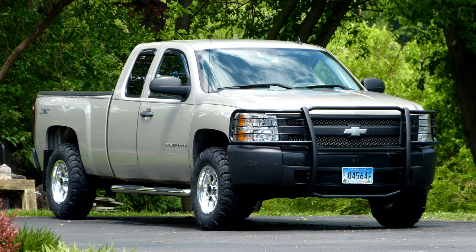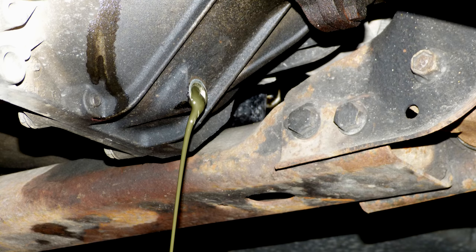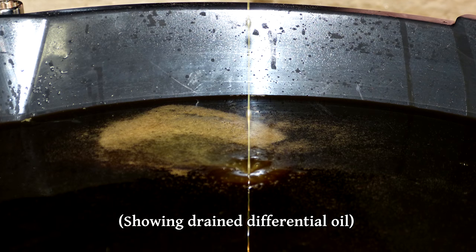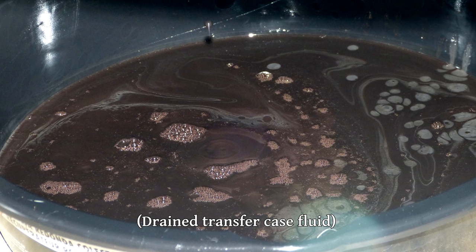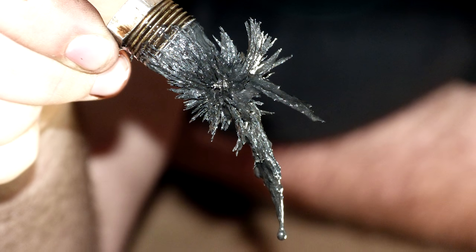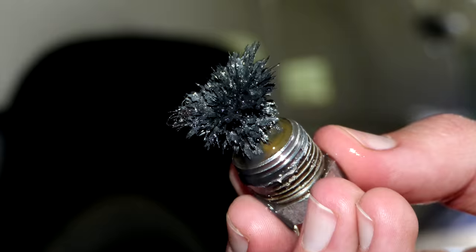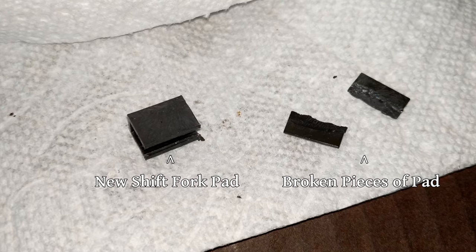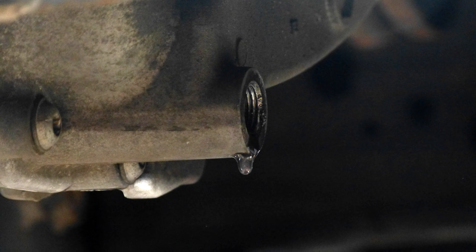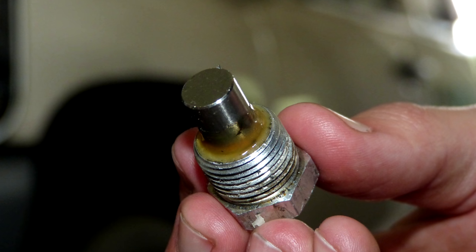Pretty soon after that, me and a friend set out to change all of the fluids on the vehicle. We changed the oil in both of the differentials, which was a good thing because it didn't look great. The oil always looked good and the transmission fluid looked fine, but the transfer case had a surprise in store. The first time we removed the magnetic transfer case plug it looked like there was quite a bit of metal. We refilled the transfer case and changed it again a couple days later — there was even more metal still in there. We also pulled out some small plastic pieces which I later learned were the pads on the shift fork. I had read online that transfer cases like to shed metal from new chains, and since I assumed this was the original fluid we just cleaned everything up, refilled it, and kind of forgot about it.